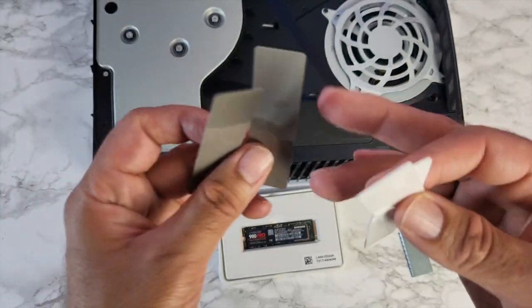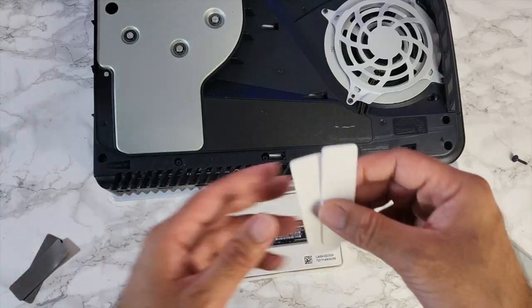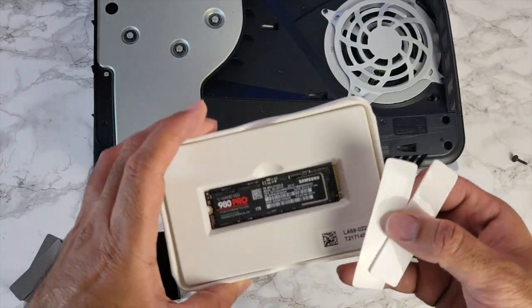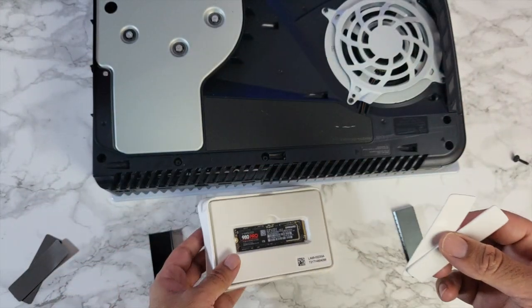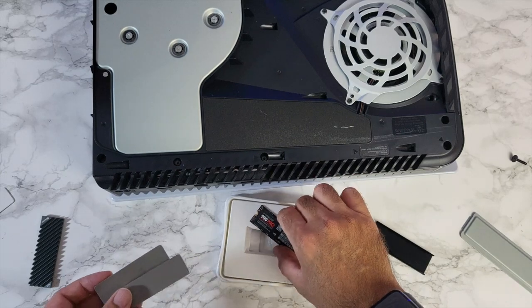So in the description, it says if you're gonna use this double-sided, then it's best to use two thin thermal pads. And if you're gonna use it just single-sided, then you can use the thick thermal pads. Or if your SSD drive is less than 2.4 millimeters in thickness, then you can use one thick and one thin in combination. So for the 980 Pro, I'm going to be using two thin thermal pads.